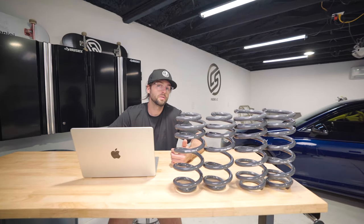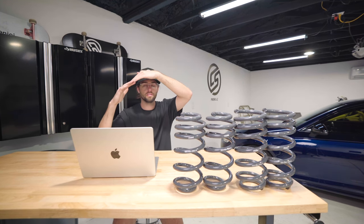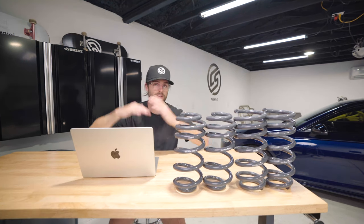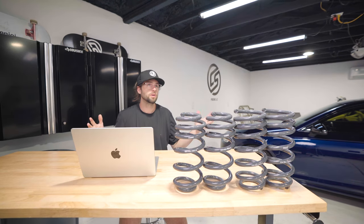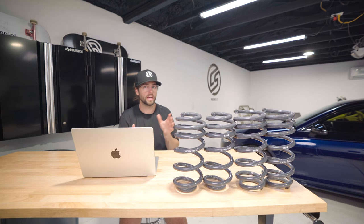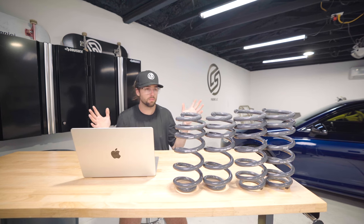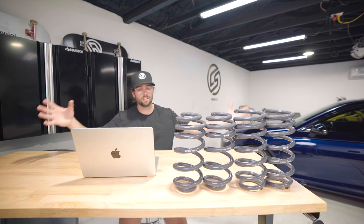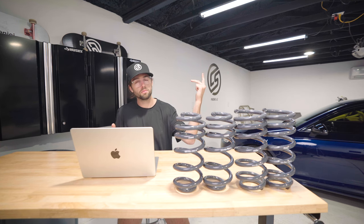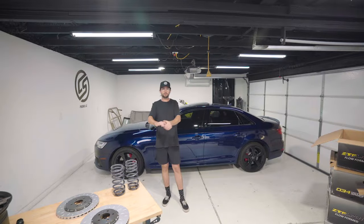Under weight, 0.9 inch lowering of the front and the rear, so you don't have a reverse rake. The rear is not going to be lower unless you got a bunch of stuff in the back. So the front is going to be slightly lower to have a positive rake that we like. That attack stance, the more aggressive look. And what are we overall looking for? Just a more planted car with these springs than before. It's going to handle well in corners. It's going to be comfortable on the road still. Everything was kept in mind and made in the USA for these springs with all those things in mind. Does it need to be expanded on more than that? It's just springs. Absolutely not. It's simple. Lower, comfortable, handles well, less body roll. Let's just get straight to it, install these, and enjoy them. It's time to wrench.